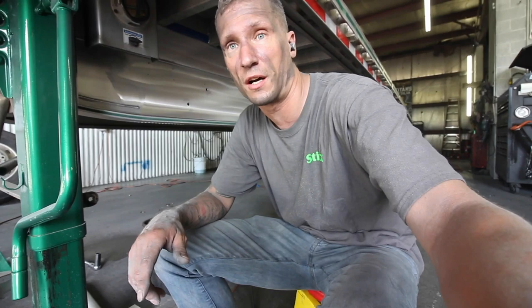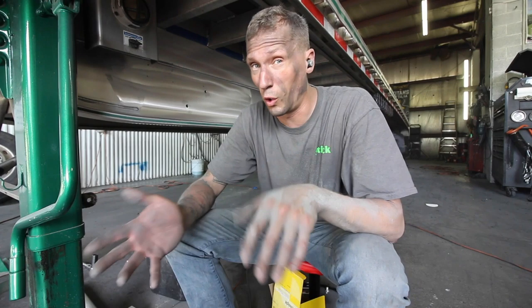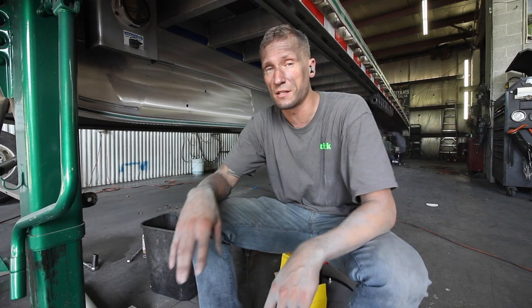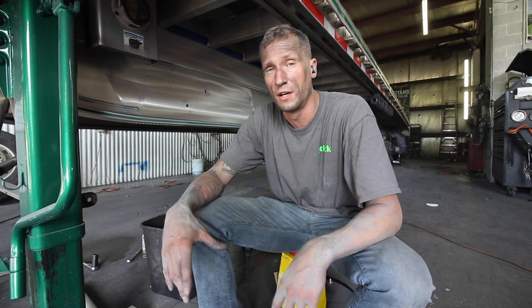The lower grits, you're gonna go through a whole lot more because you're trying to dig deeper, but the higher grits, you're gonna go through about half as much, three quarters as much. With the heavier grits, I always say buy more of the heavy grit. And then the fine grit, when you get into like 600, you'll use about double of anything else, because you really wanna make sure that you're not clogging up your paper and burning it up. So I'm gonna keep rotarying this whole thing, and try and keep up with Ty.